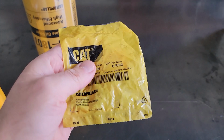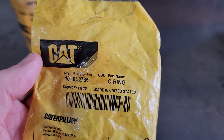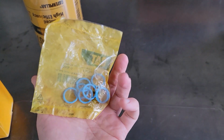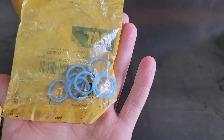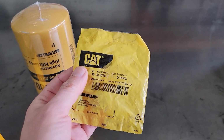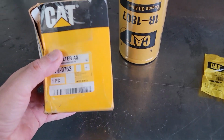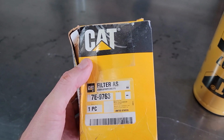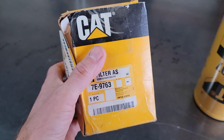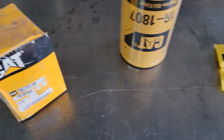On the Stewart and Stevenson trucks, here is a part number for you. This is an O-ring that if you don't put on, you're going to wonder why your oil pan bolt is leaking like crazy. So you can find these on eBay. I will try and leave a link in the description for them if I can find them again, but I bought a 10-pack. Every time you do an oil change, just replace this O-ring. It's really helpful. One thing I always do once a year as well is change out the fuel filter. We'll be doing that today. And you basically hit all of them with one maintenance session, and then you're done.